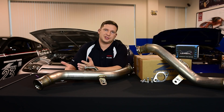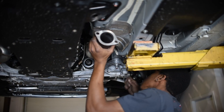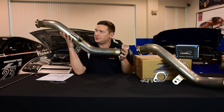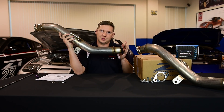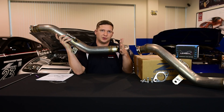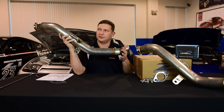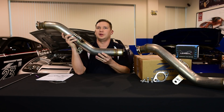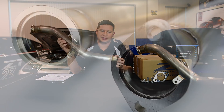Most professional installers should have all that and be able to do the job in that time. We've done it many times — the worst it's taken us is six and a half hours. Once you've got these on the car, as it is a v-band you can clock the exhaust a little bit. Usually we'll center them up so they look like they should fit in the body, then mock the rest of the exhaust back up and get everything snug before we lock down the v-band and work our way back.